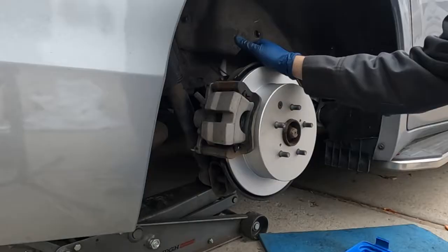That's how you can replace rear brakes on a 2013 Toyota Sienna. This spans over a few years — I'll try to do some research to find out what years this applies to and post it in the description or title. As far as breaking in your new brakes, take it up to about 30 to 35 miles an hour and then apply a good amount of pressure to come to a nice solid stop. Let off the brakes, come back up to 30 to 35 again, and do another good solid stop. Do that about four or five times. We don't want to lock the brakes up, but we do want to come to a nice secure solid stop.